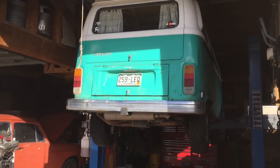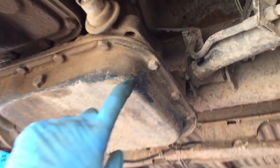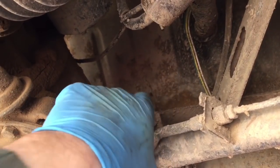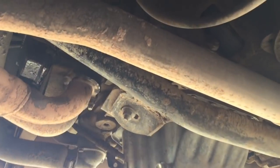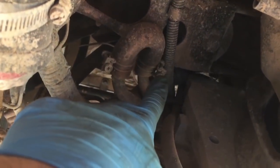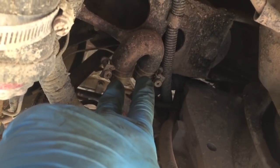Army the bus is finally getting a rear heater. Looking at the transmission, we look up here and we have the bench, so underneath the bench seat there's a wonderful platform where you can drill two holes for the 5/8 inch heater hose in line at the bottom of the engine toward the front of the van. These are the heater inputs and outputs — this is the circuit — so for the last five years I've had it looped, and I'm going to take two 5/8 inch heater hose lines and run them to underneath the bench.